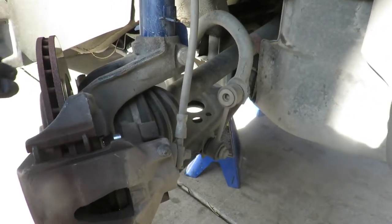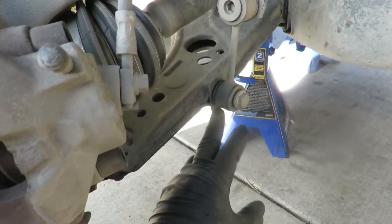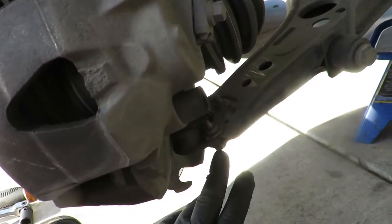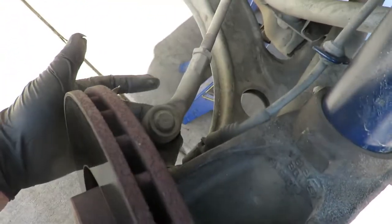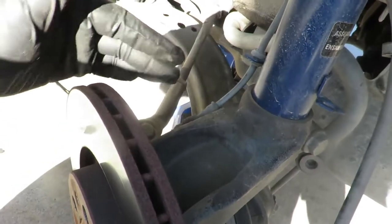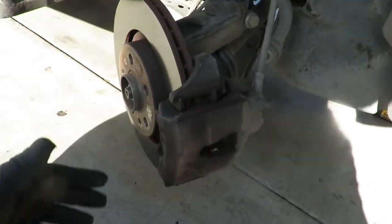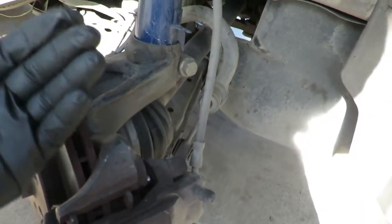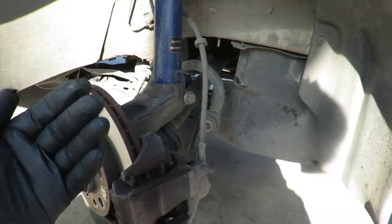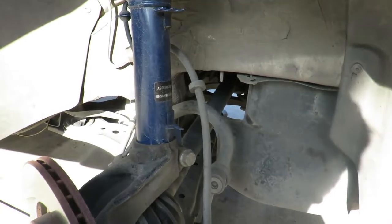All that play. To take off the lower control arm, we're going to take the sway bar end link down here from the control arm, the ball joint, and the bracket with three bolts, the tie rod end so we can swing it out without pulling the tie rod itself, and the axle so we can swing this whole assembly out to be able to get to the ball joint and the axle won't be in the way.